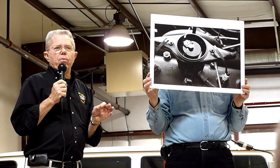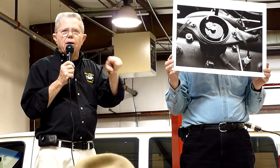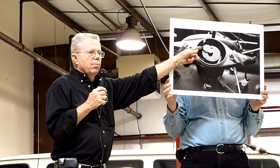So what I do is pull the number one plug, take a piece of coat hanger wire about a foot long, and if you stick it down into the plug hole at an angle — get a flashlight — you can see the top of the piston. Then slowly rotate the crank until that piston comes up and you can kind of watch the wire. Be careful that you don't get it caught in there, and it'll come up and you'll see it kind of change position, then see how that corresponds to where your timing pin is. The main thing we're doing now is with the rotor pointed at the number one post on the distributor body, we're trying to find top dead center.